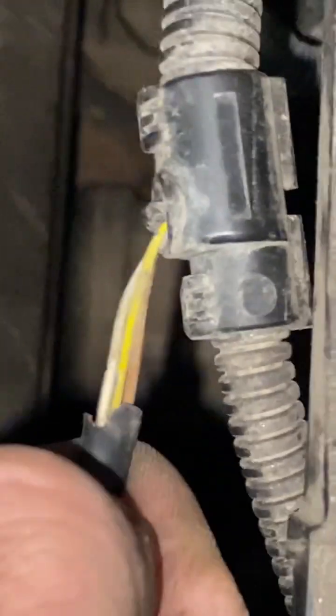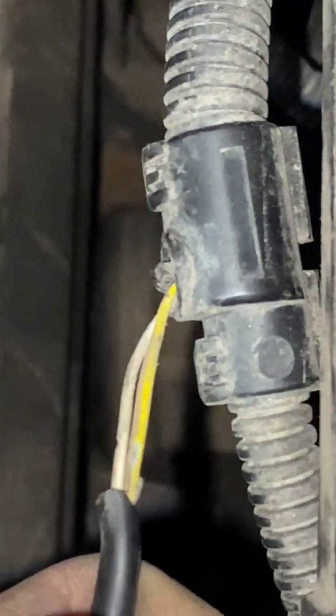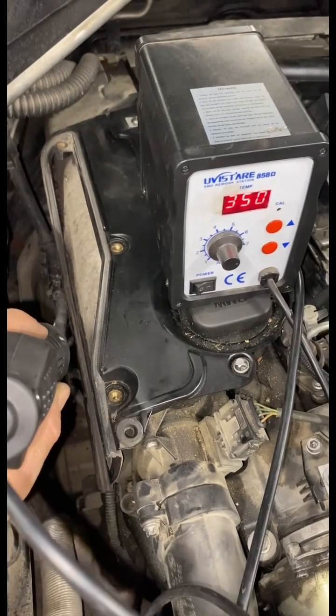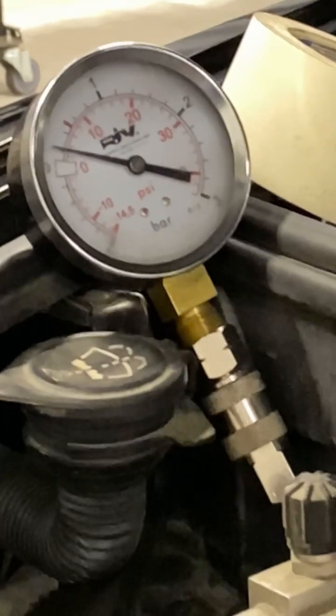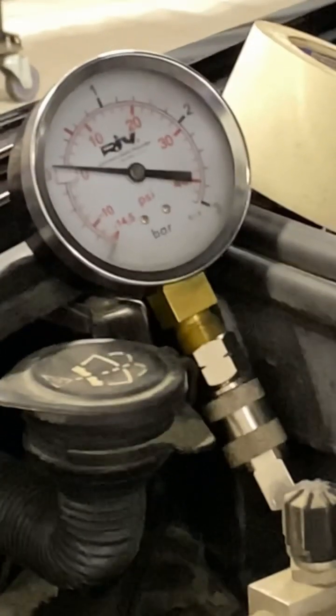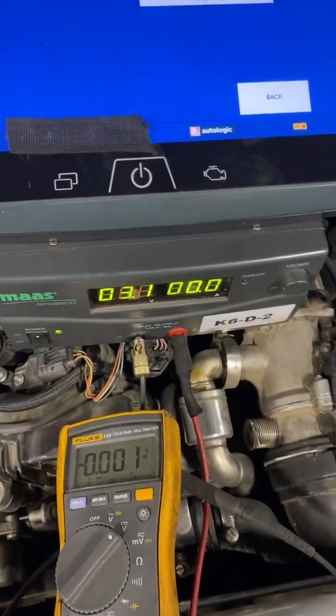It needs to be just above that to start working. I found a bad wire, I repaired it, but it still didn't work. The problem in the end was that the sensing tube was blocked where the rubber hose goes to the back pressure sensor. This is the back pressure test to confirm what I'm seeing on the car is correct, and it did show that there wasn't enough pressure.